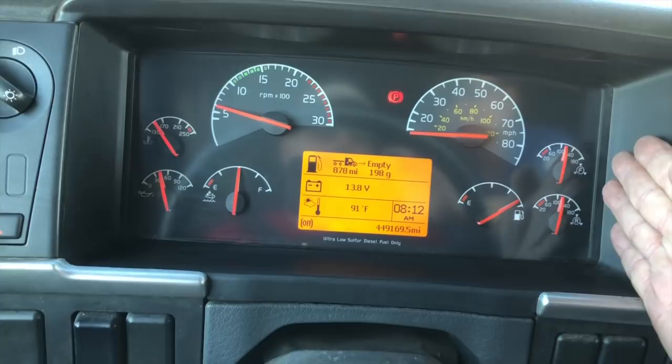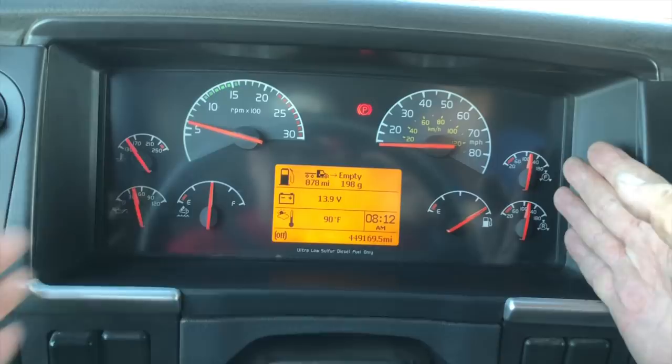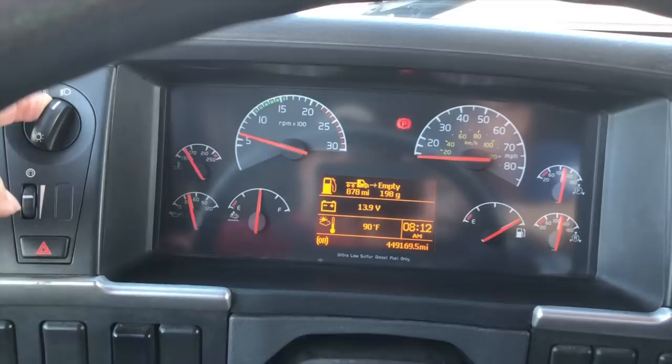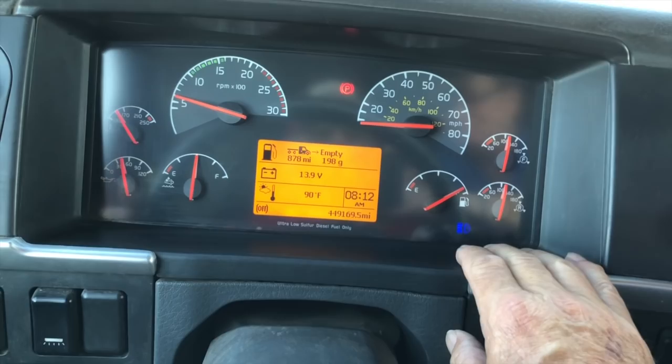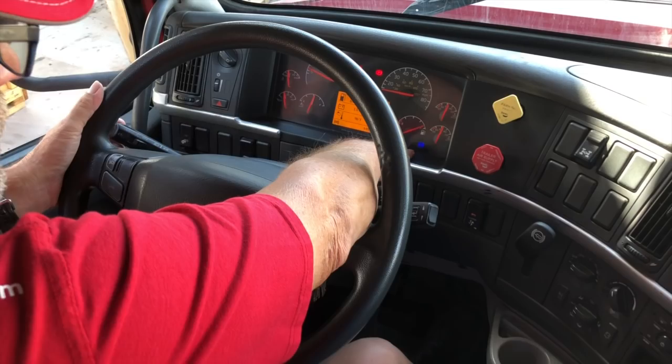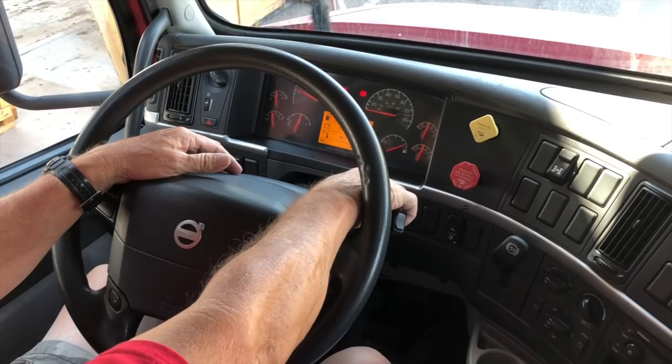To do the air brake test I'll slide my hands out. Check dash lights — they come on and off. Check four ways, left turn signal, right turn signal, bright lights, windshield washers and wipers — do they work? Highway horn. City horn.